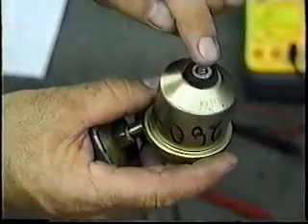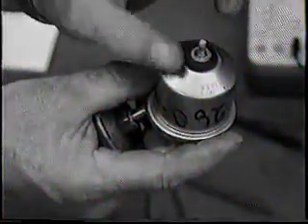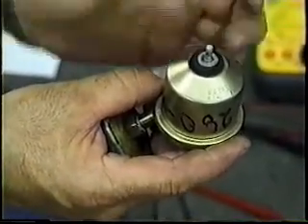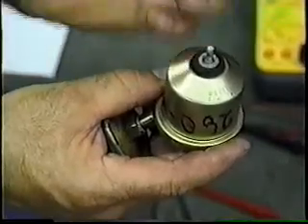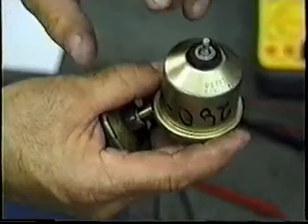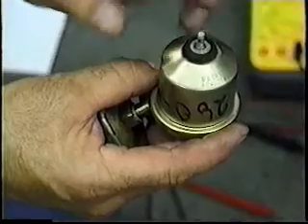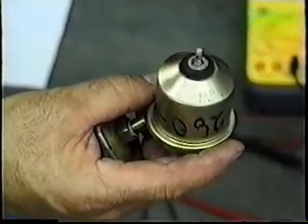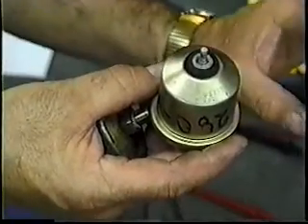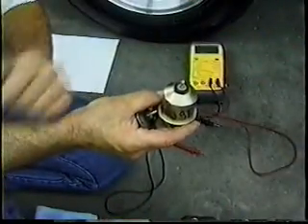The 280Z with a seven pin has only one contact, whose whole job is simply to make your oil pressure gauge read. The second contact found in the ZX and late Z styles is a grounding switch which opens and closes due to oil pressure, which turns on the master fuel injection relays. If you've got that style you'll have split relays. Look under the hood — if you've got power supplies to both sides of the battery, look for that long oblong master fuel injection relay and look for a single pin contact.